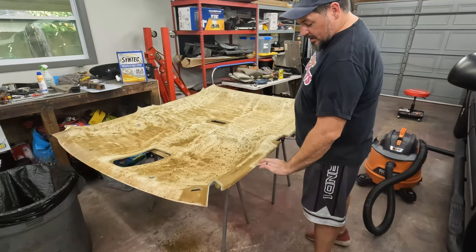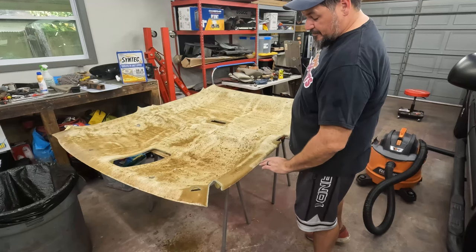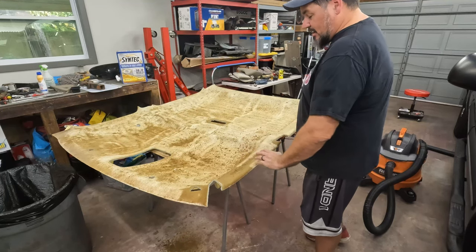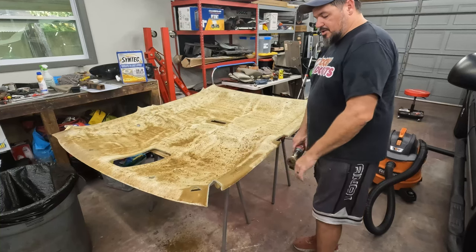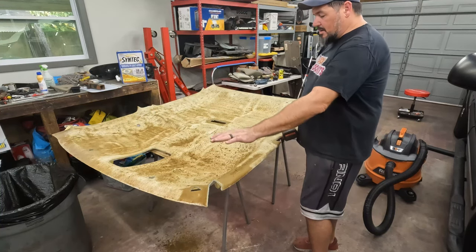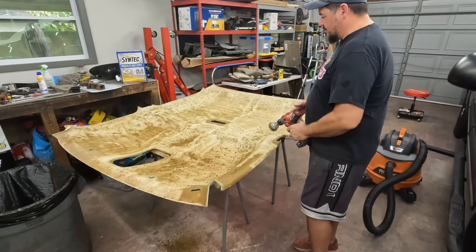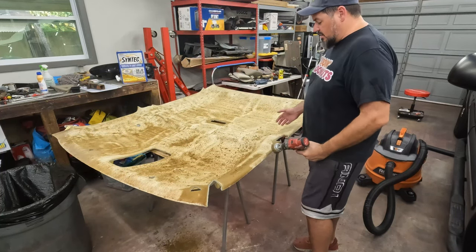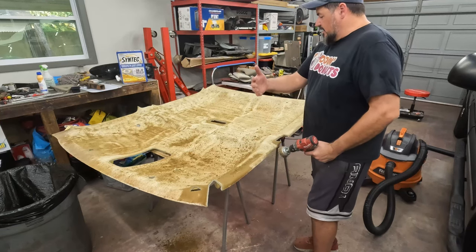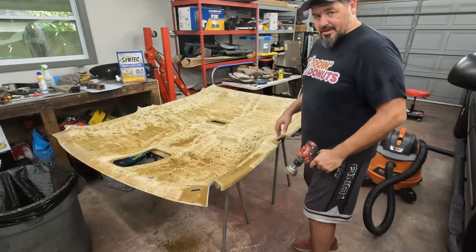So I'm really just lightly touching the edge with the brush, feathering as much as I can. Don't go grinding in. In fact, that's really true all the way around. Just let the brush do the work. Let the drill and the brush do the work. If you have to go back over three times, it's no big deal, but don't grind it down in there, because you've seen a couple of times where this tried to shoot off on me because the brush caught the board and flung it. So don't do that. That's my advice.